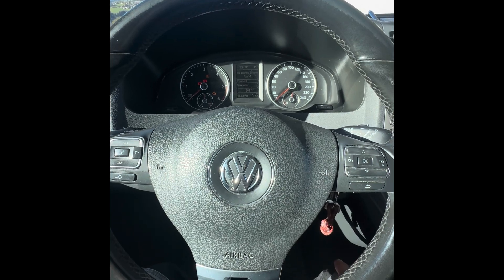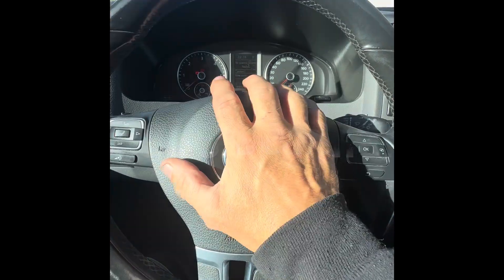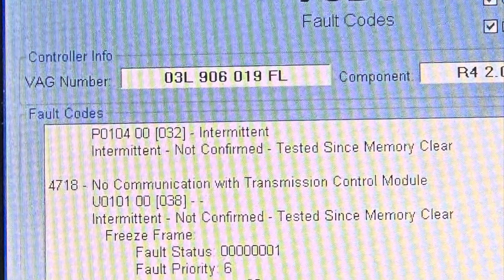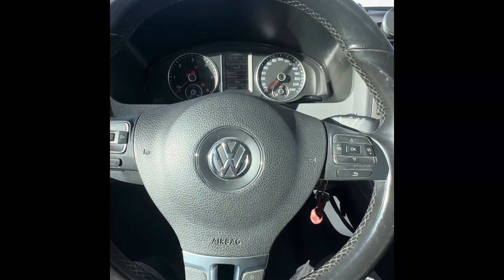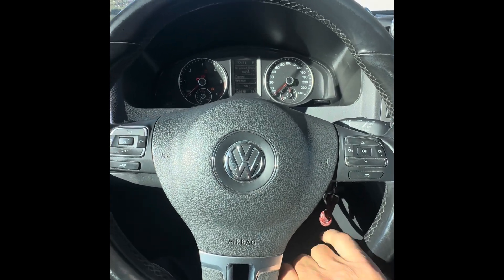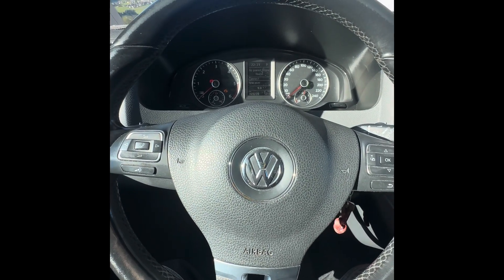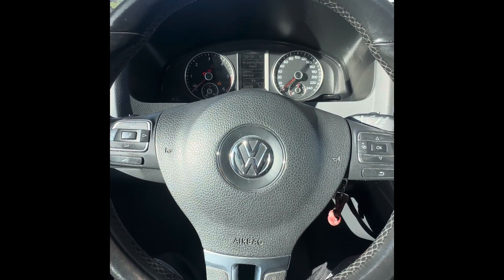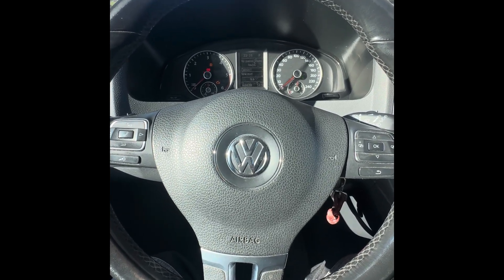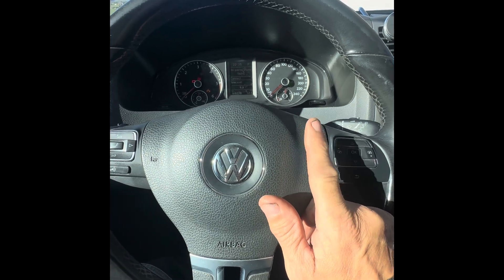The first thing you do is have a bit of a heart attack because you go online, or if you're driving and it dumps you somewhere, you're in a bit of trouble. You can try turning the key on and off repeatedly and you might get it reconnected. But basically it's saying you can't communicate with the DSG gearbox - there's no power. The power feed into the gearbox is not connecting, so there's loss of power to the mechatronic unit.